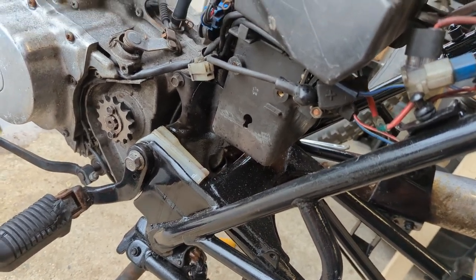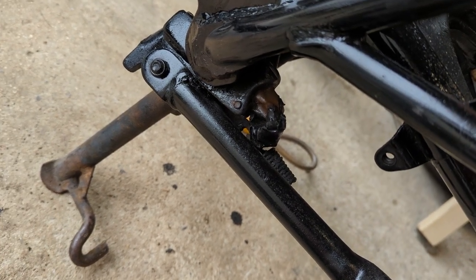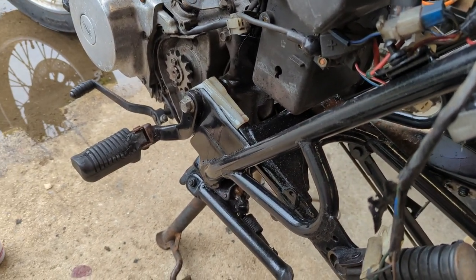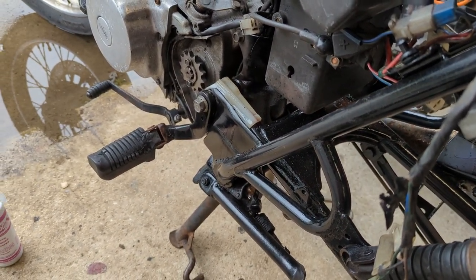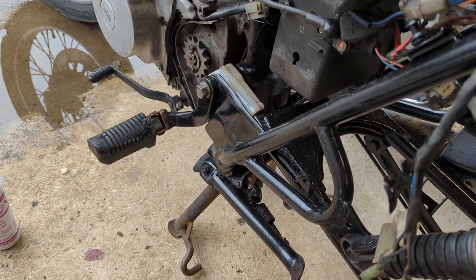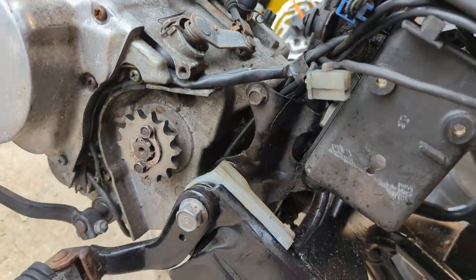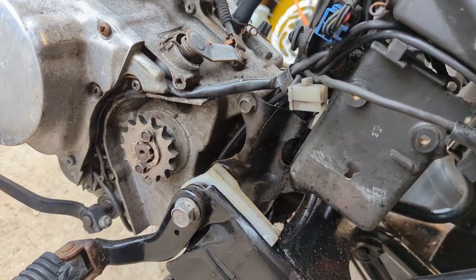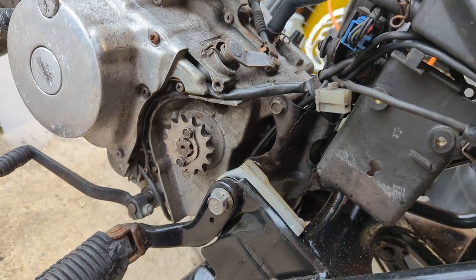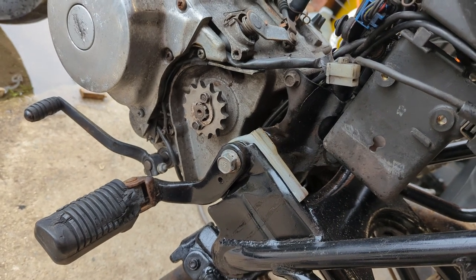There's a page in the workshop manual about that. Just looking down here, this is the side stand switch - probably going to need some love because it looks like someone's been here before. For the grand challenge I'll just bypass it, but if my other half's going to use this bike, I'll order up a new switch and sort the crusty wiring out. The other thing is I'm hitting any hidden points with ACF50 as I go, just so that they're protected later down the line - trying to get it over bolt heads and exposed metal that won't be easy to get to once everything's back together.